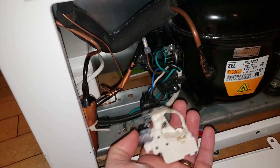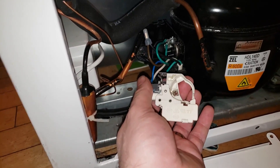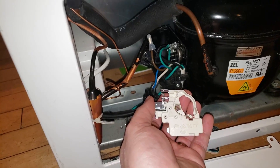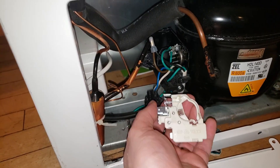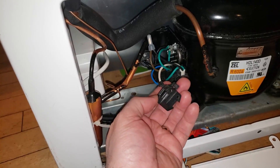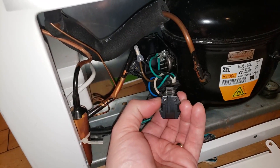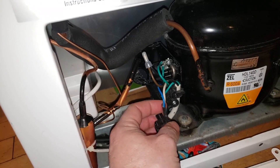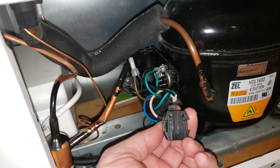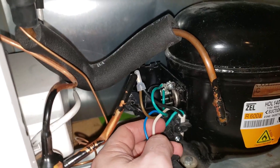What you notice is that you can purchase these very cheap universal starter relays online - as opposed to this specific one - for five dollars, sometimes even less depending on the seller. I did order one, but in the meantime I went down to an old fridge I have outside that has one of the exact same type. It's slightly different, very small - it's only got two prongs and only one input slot. I literally took the blue and white wire that were hooked up to the original one, hooked them up to this one, and these two prongs go into the bottom two pins - the three o'clock and nine o'clock positions.